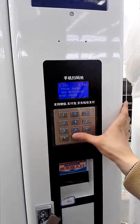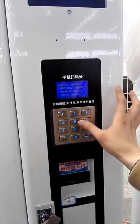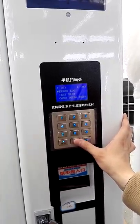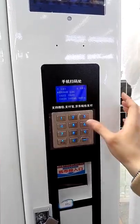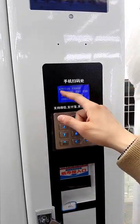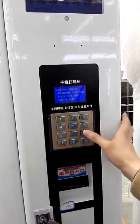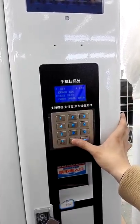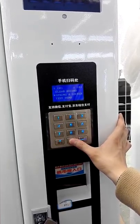There are also some other functions. This one shows total sales, daily sales, and monthly sales. Error Lock is also important — when the slot failed to vend a product, you could press enter under Error Lock, then go to Motor Error, and press enter to clear the error so the slot can be used again. Also: test the slot, cache total data, clean record screen, test event.